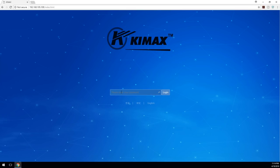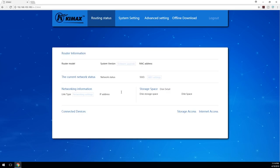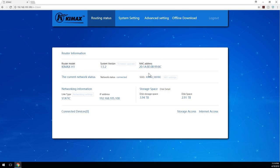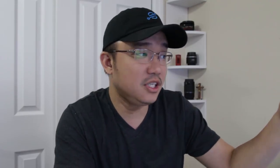As far as the user interface goes, it's very basic — you're not going to get much out of it, and I'll show you in a second. At first login, the password is 'keymax,' which you can always change later. Here you have the system dashboard with storage space and details about the storage. A huge problem I have with this is that it has no way to format your hard drives, and it needs to use ext4, which is a Linux partition — not something you can just pop into Windows and format. You need a Linux computer to format that file type.